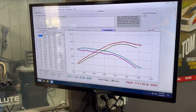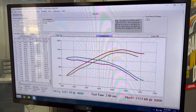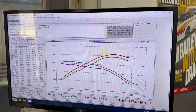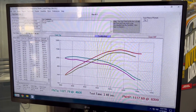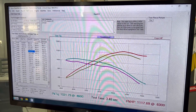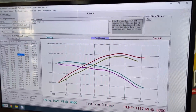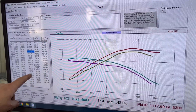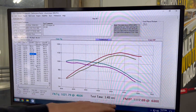That's a pretty stellar, pretty nice improvement. And our bells are billet — they're not some stamped aluminum piece of crap. It's a full-on billet bell, clamps on, real easy setup. Just take the filter off, put the bell on, and vice versa. You're looking at 41 horsepower pickup right here at 5,500. At 6,000, it is a 22 horsepower pickup. At 6,500, it is 15, and at 7,000 it would be 28 horsepower pickup. So that's some pretty nice numbers — that's a nice pickup on the bell.